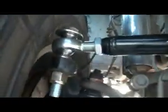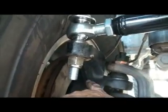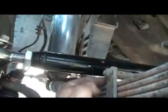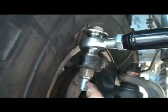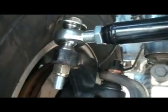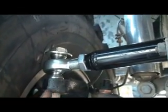So that's on that side, and you come over this way. Now this is where it goes to that steering knuckle, that aftermarket steering knuckle that I bought. It's got this extra arm on here, so it goes over the leaf spring. So that worked out good. If you're looking at my bolts and all that stuff, and this big washer, all that's coming out. I'm going to take out these standard bolts and put some grade 8 bolts in there. Right now, this is what I got to keep it rolling so I can steer it.